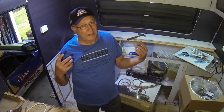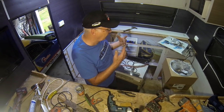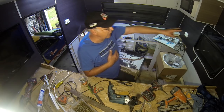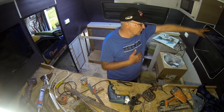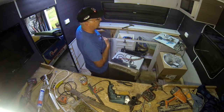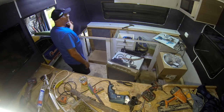To turn my caravan into a car camper trailer, I need to finish the interior renovation of the sleepover, and things are coming along really well. All the 240 volt wiring has been redone to the power points, going back to the circuit breakers, which had to be moved from where the back half of the caravan used to be, so that's all been rewired. The 12 volt wiring has been redone, all the lights are now 12 volt. And they work really well, LED units, very bright.